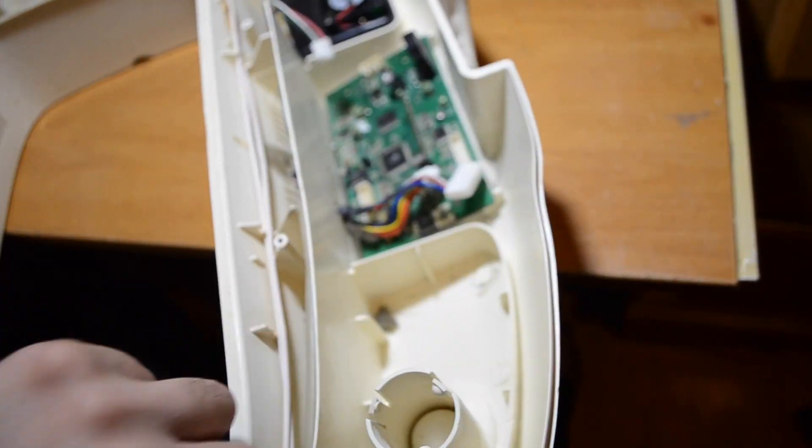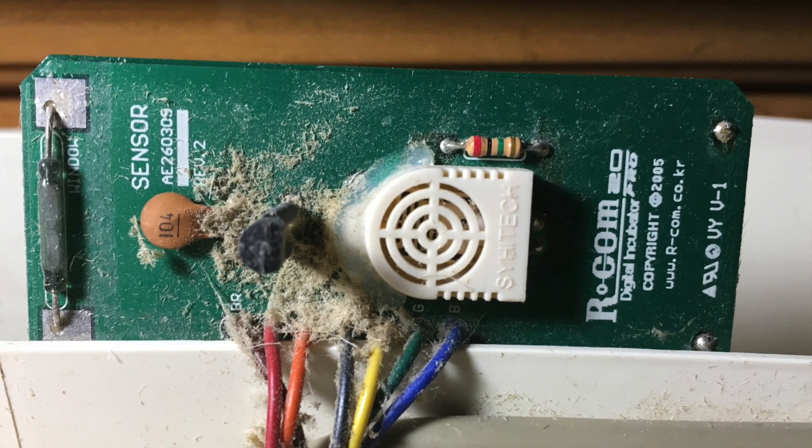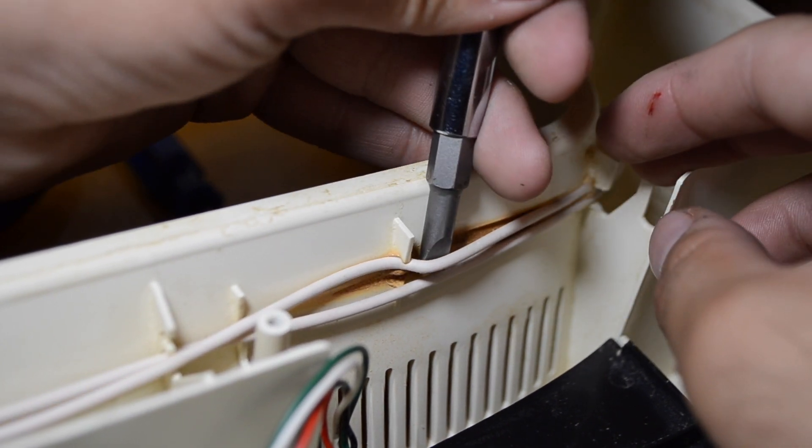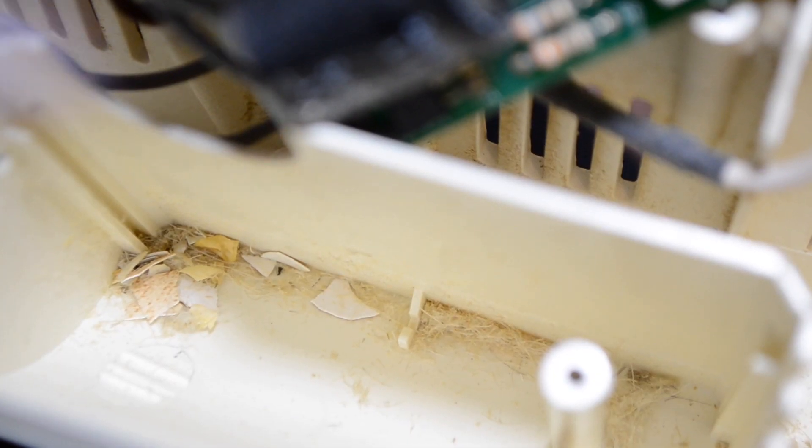I decided to put everything back together. There seems to be no authorized reseller selling these specific parts, which is tied in with the support for the incubator. This is similar to John Deere's modern tractor problem, where farmers need to take their tractors to the manufacturers for repairs — and doesn't that sound costly? In the end, I found more problems in the long run for the typical poultry breeder. The dust adherence is not something a vacuum can clean over the vents, as the manual states. The heating elements burn the plastic, destroying the incubator.